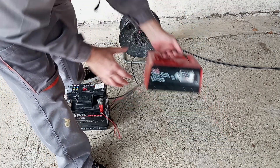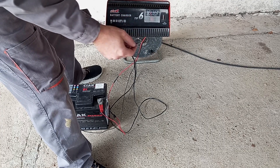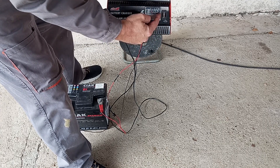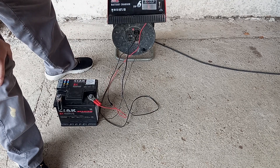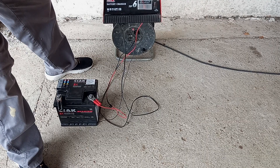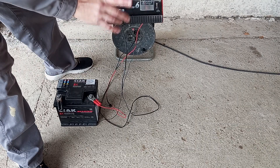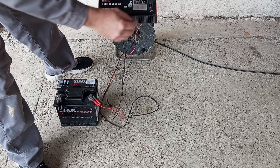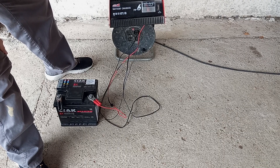On these analog chargers, once you connect the battery, the scale moves to show how depleted the battery is. If the battery was totally depleted, the gauge goes all the way to the right, then slowly falls back to zero as it charges. When the needle is on zero — which may take several hours — the battery should be full. One tip for knowing if your battery is good: some batteries, when run flat a couple of times, have damaged lead cells that won't charge anymore. You'll see this with the gauge — when you connect, it goes to zero very fast, in half an hour or an hour at most. If you see this, there's a good probability the battery is damaged and you need to buy a new one.